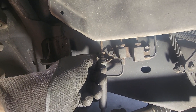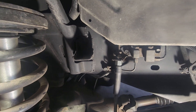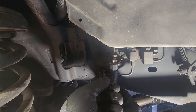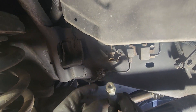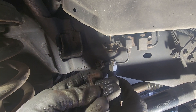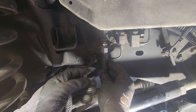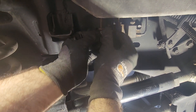I didn't know, I just started going at it, and I discovered that this has a tab right here. So this is your brake line — the new one — and it has a tab. You're gonna pull this out, and when you pull this out, the hose has a shape to it that allows it to come through this space right here. This pin right here slides through there and that locks it in place.